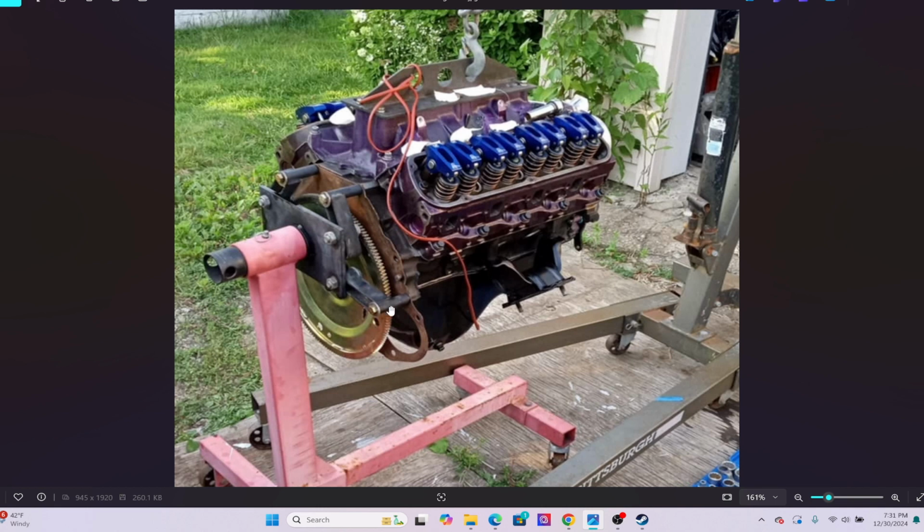The torque converter was built for that transmission. The flex plate is usually going to fit within that spec, but you definitely should make sure that it's moving, because it could even be a manufacturer defect or something like that. But again, how I checked it: moved it all the way back, moved the converter back, put some tape on the studs, looked through the starter motor hole. They gave me just enough.